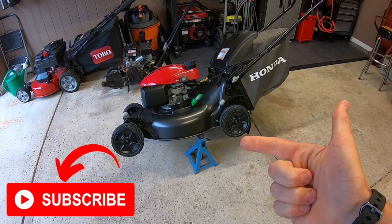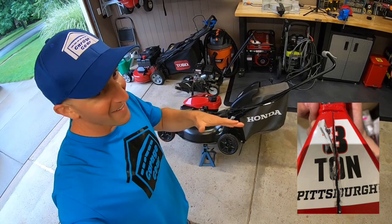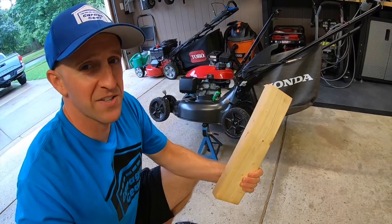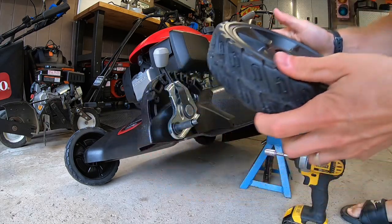So here's what we're going to do. We're going to tip the mower up on one side. A jack stand should work just fine for you — those Harbor Freight ones, though, nowadays, they're a little iffy. You could even use a couple blocks of wood. You just have to get the mower a couple inches off the ground. Take your 12-millimeter socket, remove the bolts from the front and back wheels, and slide the wheels right off.